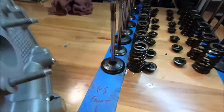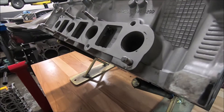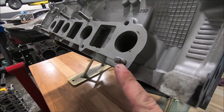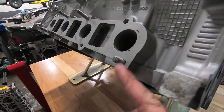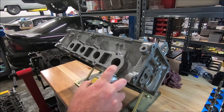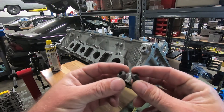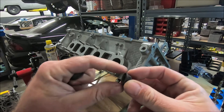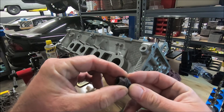The intake valves looked okay on this, so I'm just going to clean those up before we put them back in. One thing that's pretty common with these when you take them off is a broken stud. This one's broken with enough left over that I'm going to put two nuts on there, jam them together and see if it will come out. I've got to put some PB Blaster on it. Then using two nuts from the headers, I'm going to put one on upside down so the flat portion is facing up, and then jam the other one up against it.